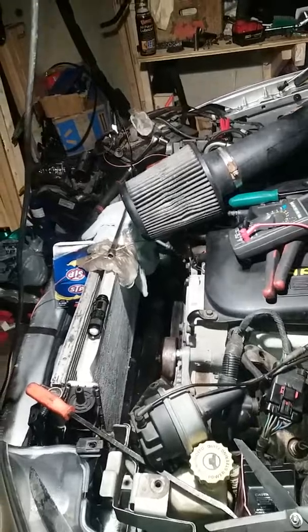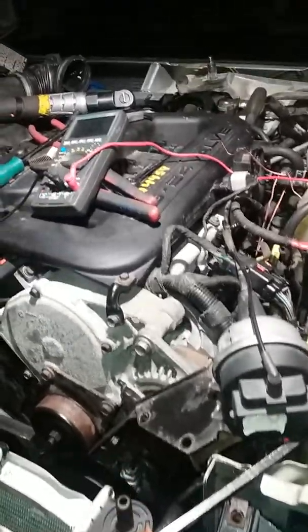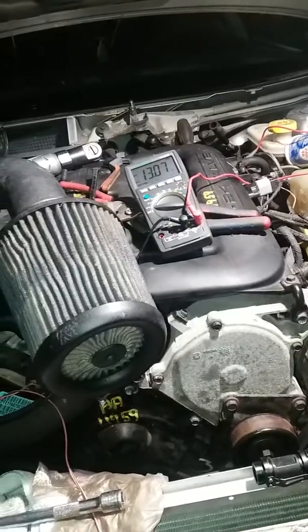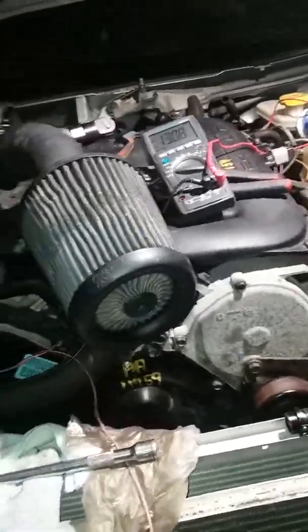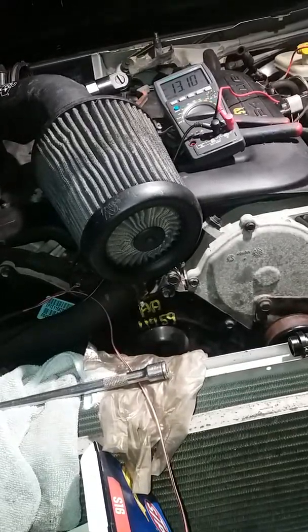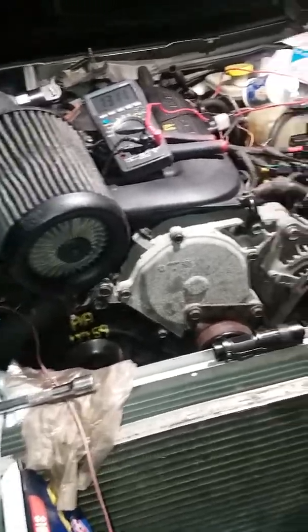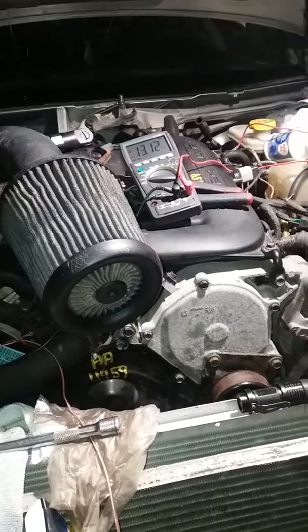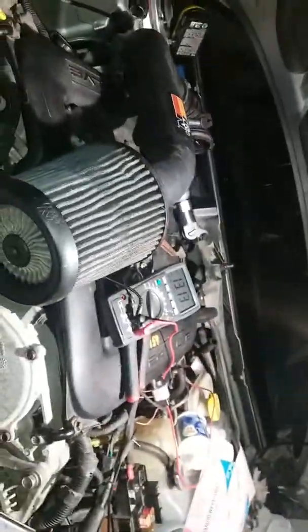This is something interesting because the conventional test everybody's asking me to do is not working. Either this car is wired differently or something. The starter test I'm doing to verify if I'm getting voltage at the signal wire — initially when I did it in my black car I wasn't getting 12 volts, I was getting some millivolts, five-point-something. I wouldn't even get up to one volt, so I just couldn't figure out why.